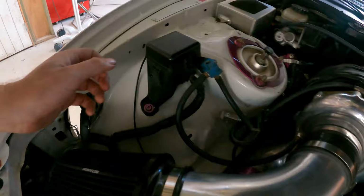All right, guys, we're back with the Supra. So I had to do a few little things to set it up exactly how I wanted. Change the boost control. It's got a GFB boost controller in at the moment. I actually repinned in the factory boost control and just pinched the solenoid, rewired it, and so we've got ECU controlled boost now. The boost is now controlled by our Link.